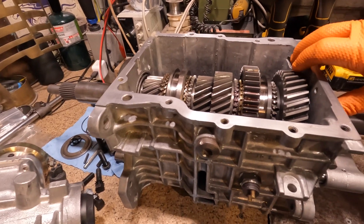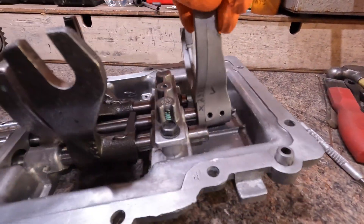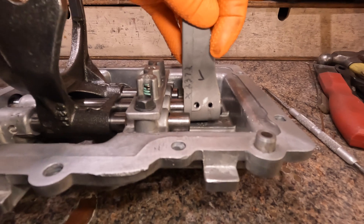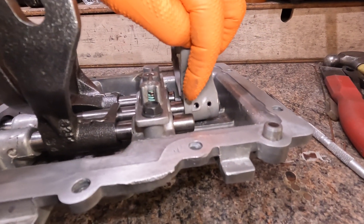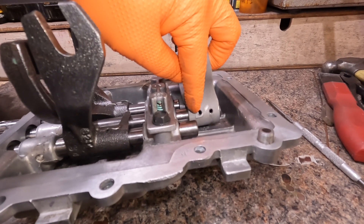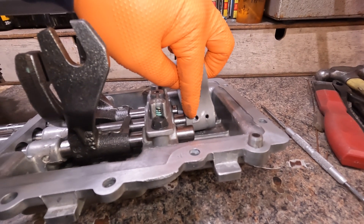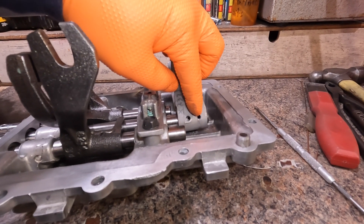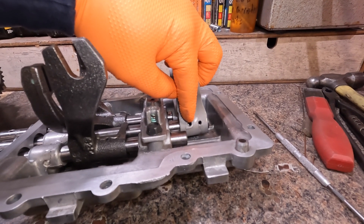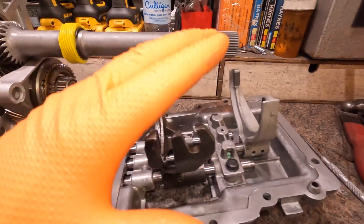What was happening was the fork was being held to the rear, which lines up with the shift fork. If you look inside this rear hole, the hole for the metal shift rail is forward and out of orientation - it's in orientation for the face plate setup. He said all I've got to do is knock this roll pin out, slide the fork forward, reinsert the roll pin back in that hole, and that's where it wants to be, and everything should work.